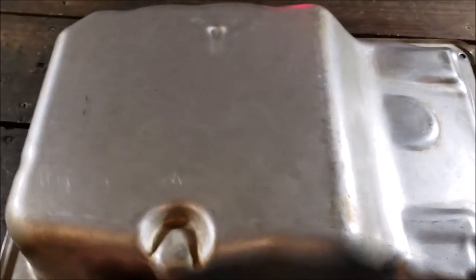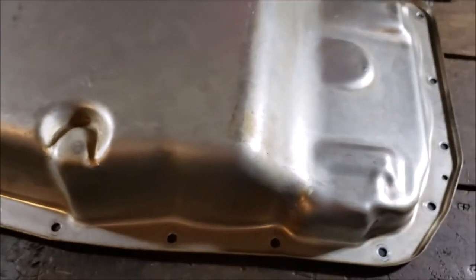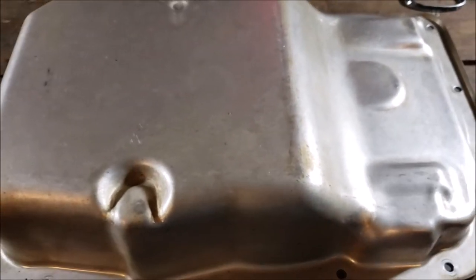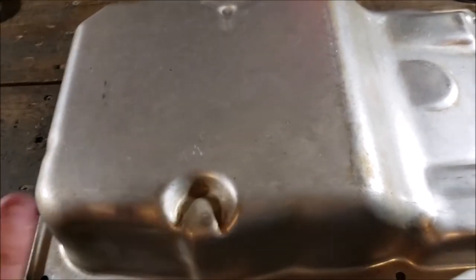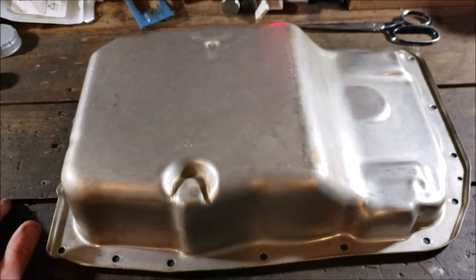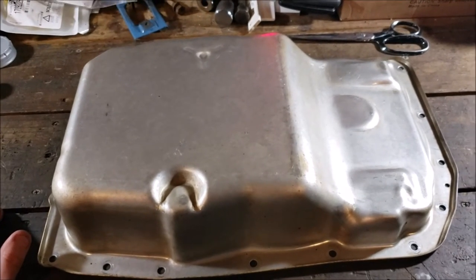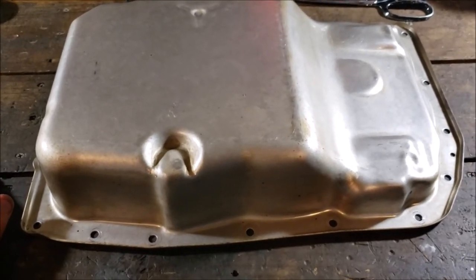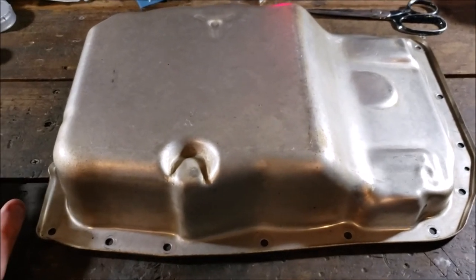You don't have to go through the pain of dropping the pan every time — just drain your fluid first. Like the old 700R4s and 4L60Es, you just buy a new pan — Pioneer makes a $30 pan that works great for a stocker. But I cannot find a steel aftermarket pan for the 6L80E. I found one aluminum one and they wanted $280 — that was the only one I found.